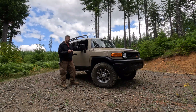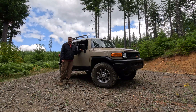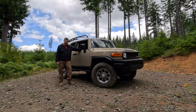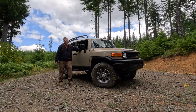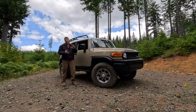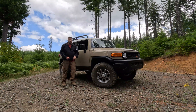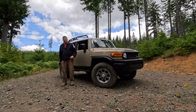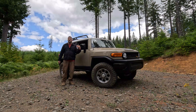I was running 35s on this before I decided to put gears in it. The stock gear ratio — 3.73 to 1 with 35-inch tires — I was trying to scale up the mountain coming home from work every day and the FJ would fall flat on its face. I'm giving it maximum pedal, it downshifted to third gear, winding out so hard and still not getting up that hill — everything on maximum overload. After I decided to re-gear, I put 4.88s in it. Thanks to gear calculators all over the internet, you can find a dyno sheet showing where your vehicle makes its best power and torque, and use an RPM calculator plugging in your desired tire diameter, gear ratio, and RPM.